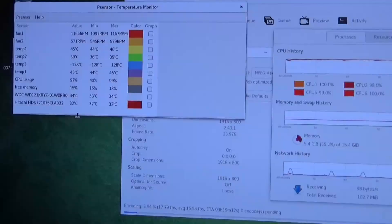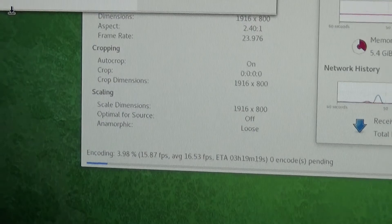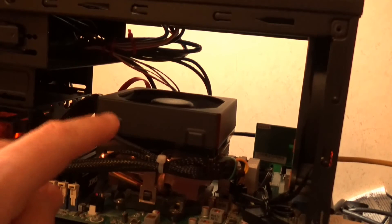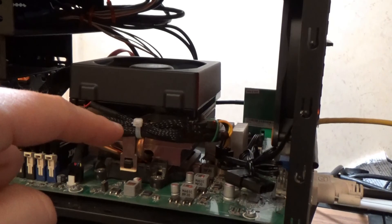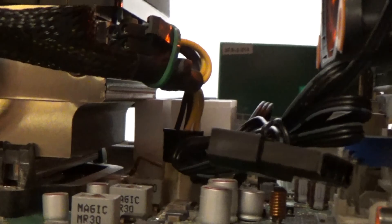It's been running about five minutes — all six cores still pegged — and it has leveled off at about 45 degrees. This AM3 socket Wraith cooler from AMD is a 125-watt cooler, but the CPU is a 95-watt chip, so we should have no problems with thermals. The contact point that was a little concerning seems like it just made contact as the cooler was seated and has not negatively impacted thermals. We are good to go.